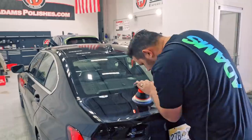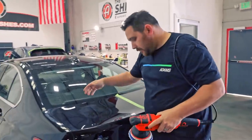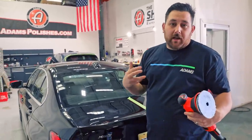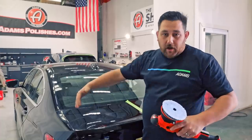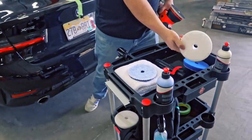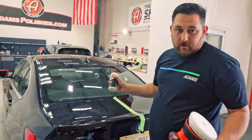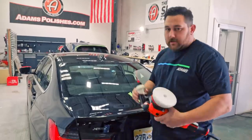I got most of these scratches out, but one thing I do see is it's a little hazy, which is natural when you're using compound and a microfiber pad. Being the most aggressive method of polishing, you're going to get a natural haze — it's just the reality. That doesn't bother me because I know I can get that out with the polish. Really what I'm using the microfiber and compound for is to get the deeper scratches out first, and then I go back and reduce the haze and make it a mirror finish with the polish. So get the polish going — color-coded white with white, super easy. Centering it with the center hole on the pad and the polisher. I didn't wipe off the compound; there's no reason to. I've worked through it enough so I can just go straight over the top of it with the polish.